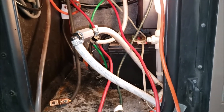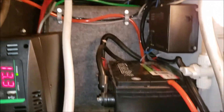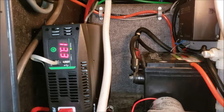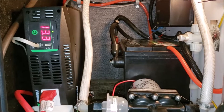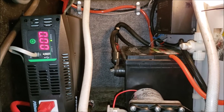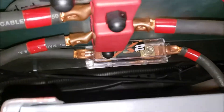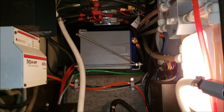Here's the great reveal — I think that's going to work for me. I remounted the water pump down low, got my wires all tidied up, and my nice 2000-watt inverter is in place. I've tested it and it's working. The only things I had to change going from 1000 to 2000 watts: the manual recommends a minimum of single-aught cable, but I've got double-aught welding cable — 2-aught cable right up there. And I increased my fuse from 150 amp to 250 amp. Everything's in pretty good shape.